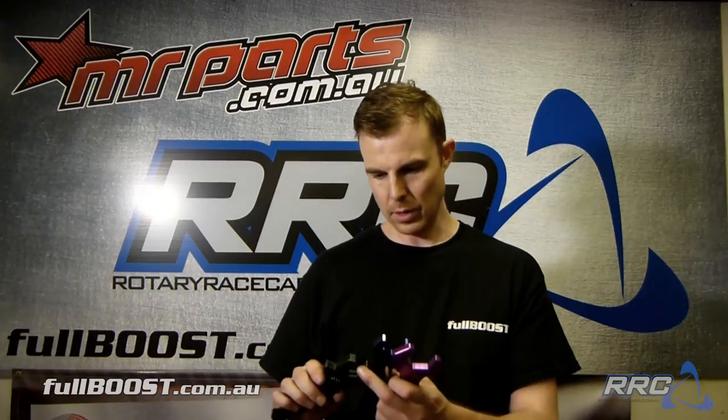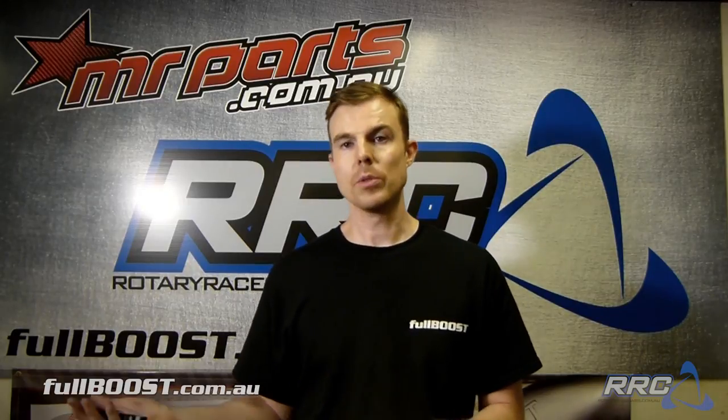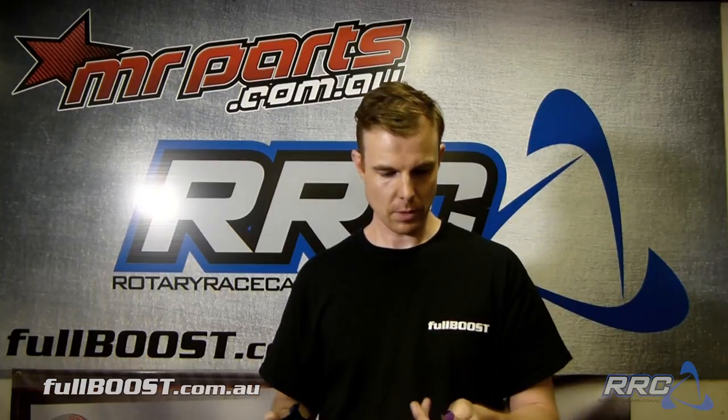Because they're aluminium, they're soft, so they won't damage the fitting and they also won't mar them or mark them. So if you're using your normal steel shifter or spanner or something like that, you'll know that they can bite into the aluminium and leave a mark on your pretty expensive fittings that you've just spent a lot of time and effort assembling.